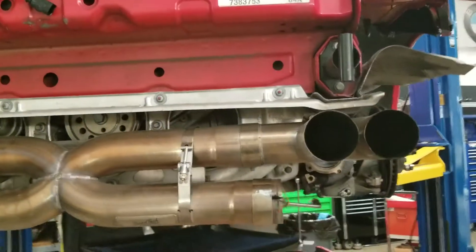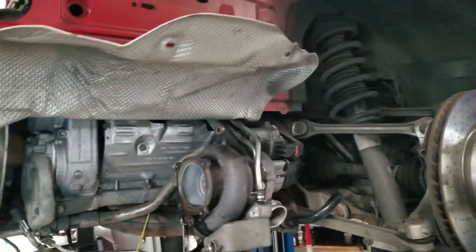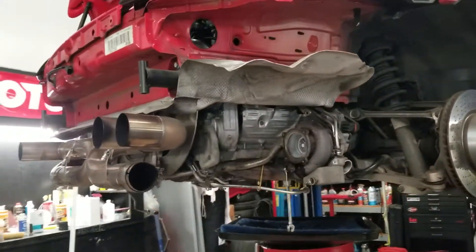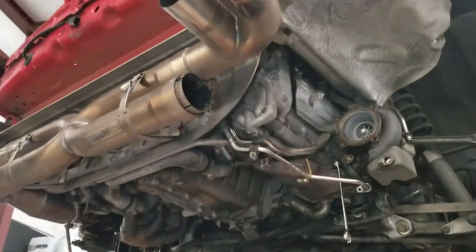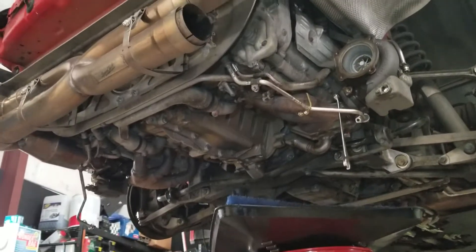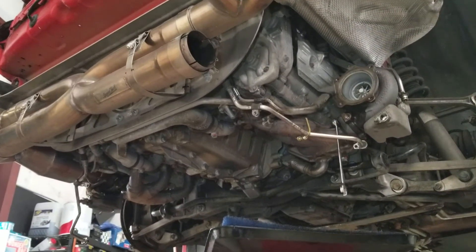The coolant hoses will get upgraded as well because these can blow. We also stress that the radiators should get upgraded — we upgrade them to a higher flow rate, between 30 and 40% more coolant flow, so they can keep up with all the heat generated by the increased horsepower. That's pretty typical for this engine. I hope this video helped somebody — comment below and I'll try to answer your questions. We'll see you next time.